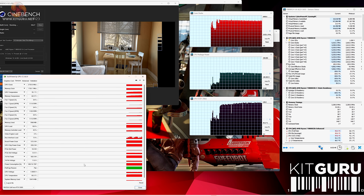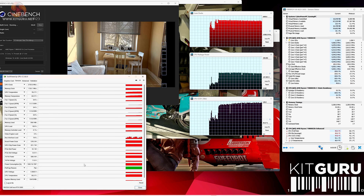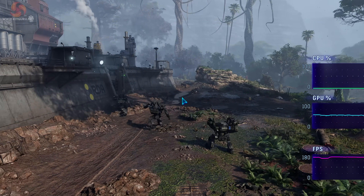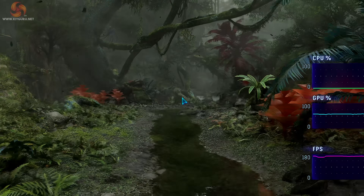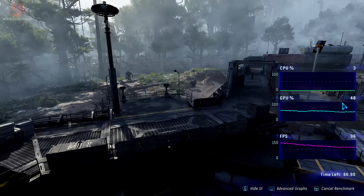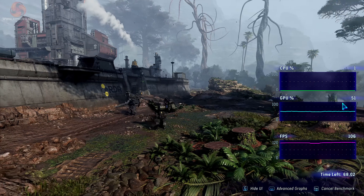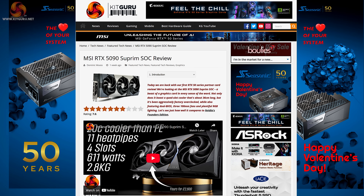Graphics temperature is north of 70 and south of 80. It's worth noting it's a very cool day, ambient just below 20°C. Before we get into the benchmark charts, this PC and the RTX 5090 are all about 4K gaming. In Avatar Frontiers of Pandora at 1440p, the GPU draws 330 to 340 watts; switching to 4K, the GPU draws 550 to 560 watts — a clear increase of 220 watts. This CyberPower PC is aimed at the gamer who wants to play at 4K, and I strongly advise you read and watch Dominic's review of the MSI graphics card for a taste of the epic gaming performance.